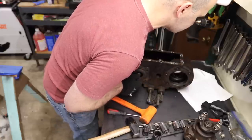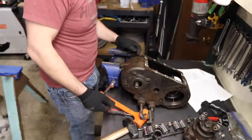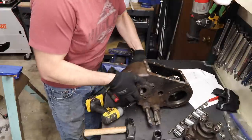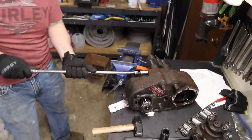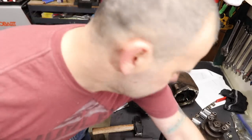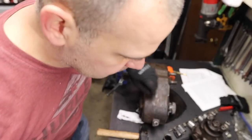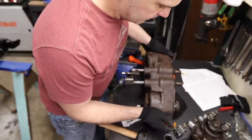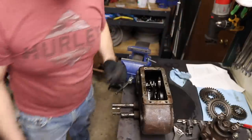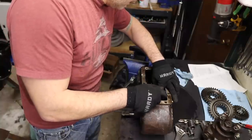Remove the shift linkage plugs or switches from the top of the front output cap. I'm going to take the detent balls out of this. I don't know how much tension these springs are under — we're going to find out. Not much apparently. Loosen the lock screw that retains the shift fork to the rod. Here's my assembly — janky. No slop at all on that drivetrain. Wish me luck guys.